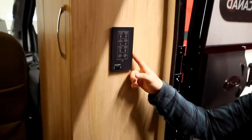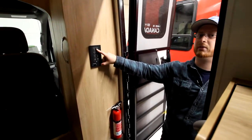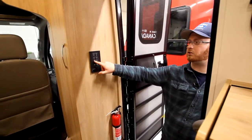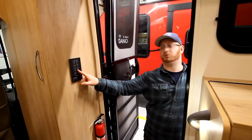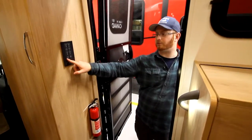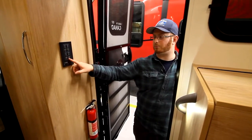To the right of me, we have our fire extinguisher and our main control panel for our lights — this is a switch panel. As you can see right now, the lights kind of dim overhead, so these are dimmable. Just keep holding them and they'll go pretty much dark and then get all bright again. A single push turns them off and on. We have assist handle and exit baggage — this is going to be the single light in the back of the unit. We have our awning light, which is also dimmable, so if you don't want so many bugs you can dim that light. We have a master on and master off — what the master lights do is save the settings. So if you have your lights dimmed and you turn everything off, when you turn it back on, it's going to have the same settings you previously set.